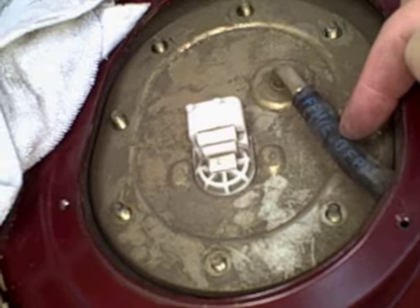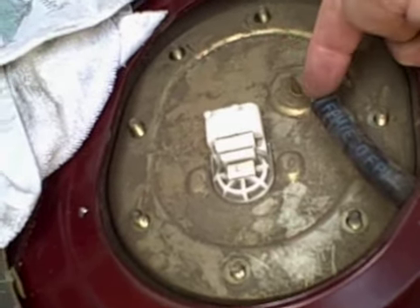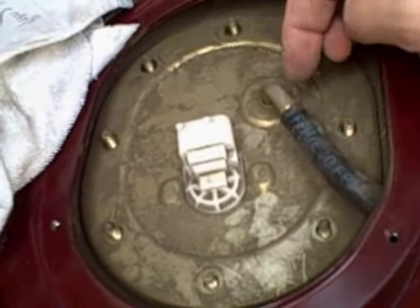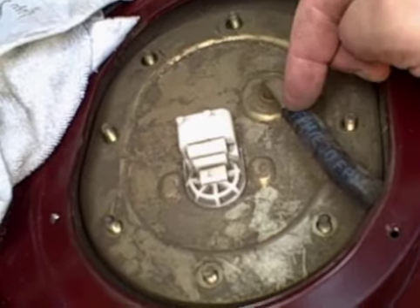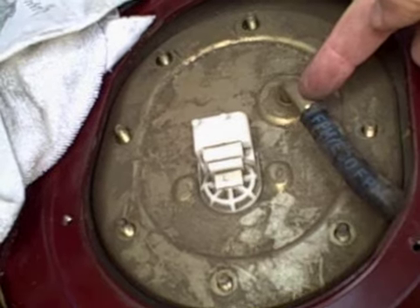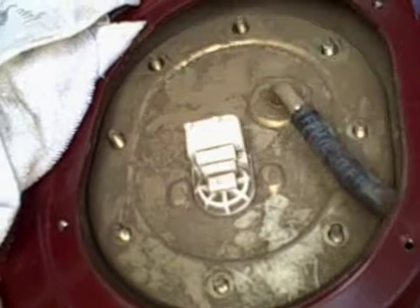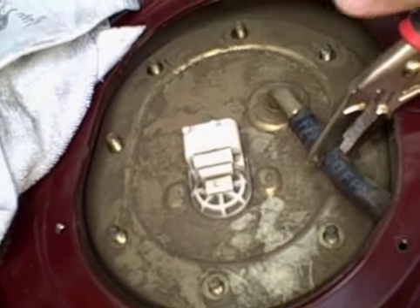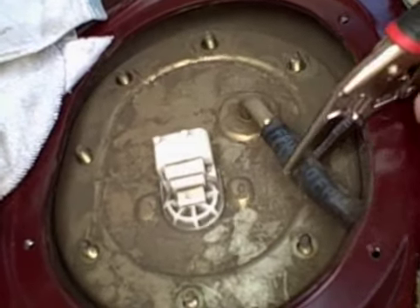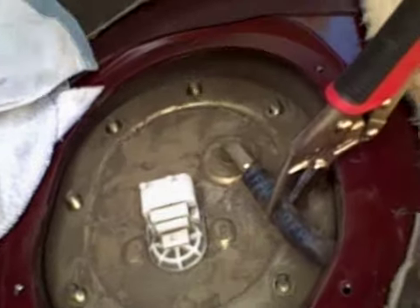What I need to do is pinch off this hose — this is the fuel line. The pump pumps it up here, underneath the car, up to the fuel rail. So this is going to drain backwards when I disconnect it. I want to make sure I have this pinched off as I get it off of here. Once I get it off, I'll be able to raise that up. So I'm going to pinch this hose with my grips and wiggle this hose off.